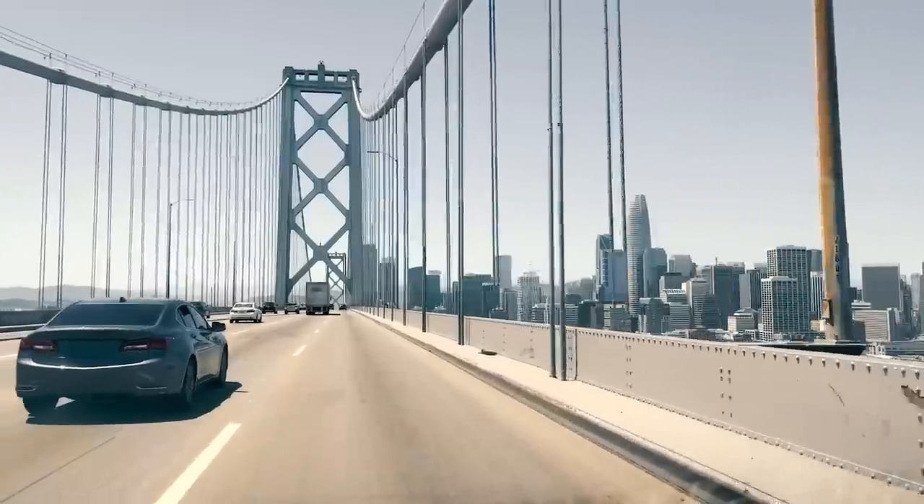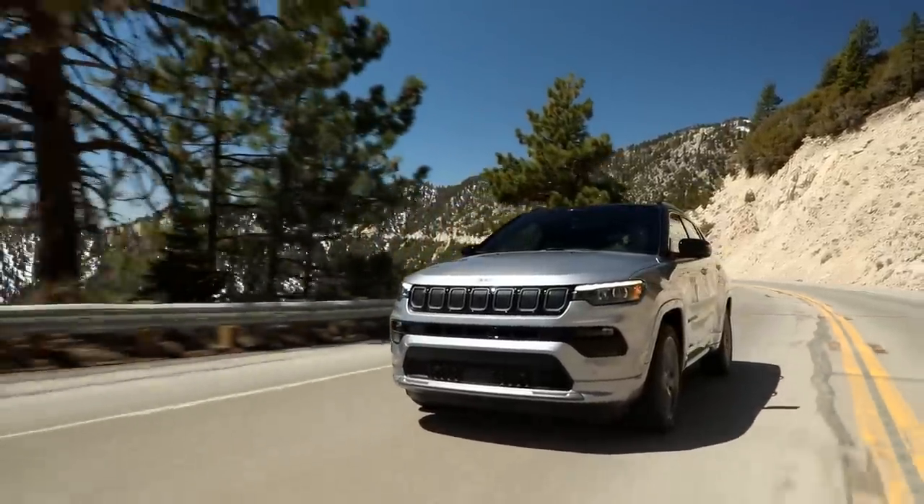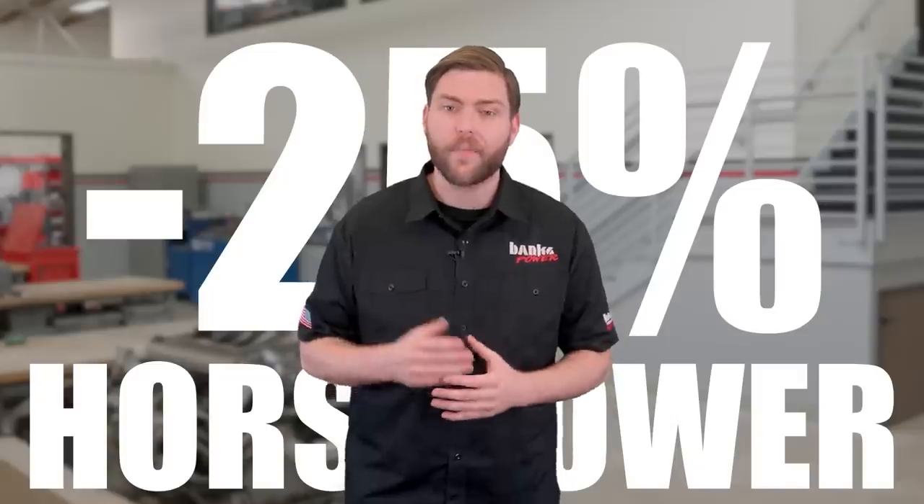Let's say you dyno your truck in San Francisco in the winter near sea level, and then in Denver in the summer at 5,200 feet. A dyno sheet with a correction factor would show no difference. But from sea level to the elevation of Denver, the average ambient air density drops about 14% from elevation change alone. On top of that, if it's a hot day, you could be losing up to 25% of your horsepower in the mile-high city — there's less oxygen in the same air volume. If you're about to tow a load over the Colorado Rockies, you care less about the corrected horsepower and more about the observed horsepower you're actually making. If you're taking your vehicle to a dyno in your area, make sure you're getting both the corrected horsepower and the observed horsepower.